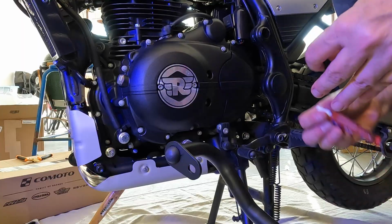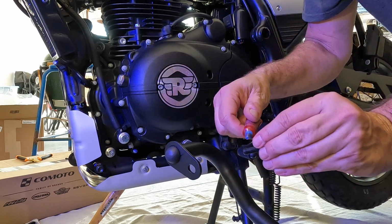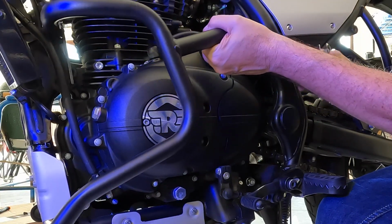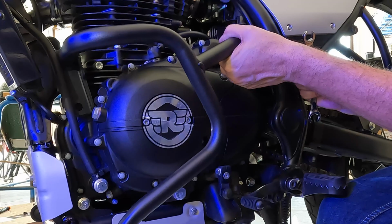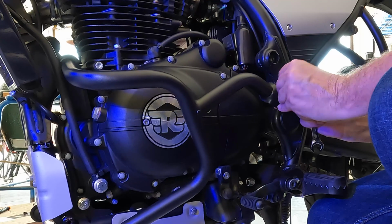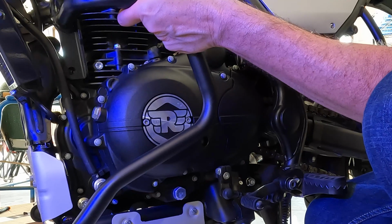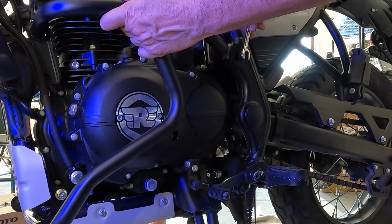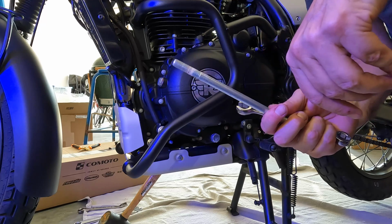One in. All right, let's connect this back one. I'm gonna line this up with best we can. This inside rod does not come through very far. You can see it, but that's about it. And so it's best if you have somebody push that through, because you're not gonna tighten anything, so that you can reach it. Once you reach it, you go ahead and make it snug a little bit. There we go. Next up, it's time to put this bolt through.